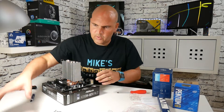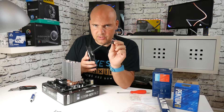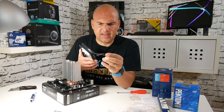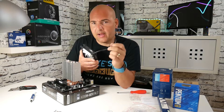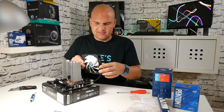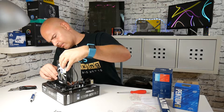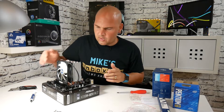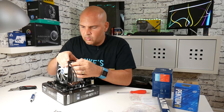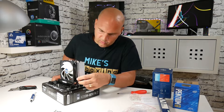First, reattach the fan header. These fans come with a PWM splitter so you can attach another fan — if you're in a system lacking PWM fan headers, you can attach another fan to the same header using its PWM sharing technology. Connect the header to your PWM CPU cooler header, then attach the fan to the brackets or clips. With this cooler, if you've got any RAM clearance issues, the clips are pretty pliable so you can put them pretty much wherever you want. If you're not using the splitter, just tuck it behind or underneath the motherboard when you install it.